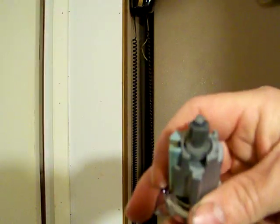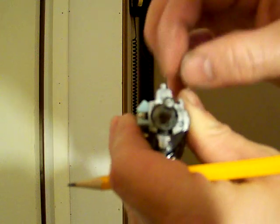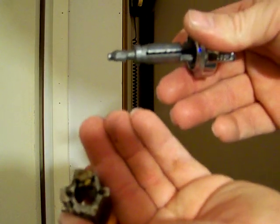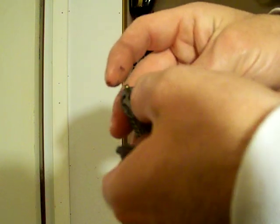There's a pin right here — what you want to do is pop it out just a little bit; it won't come all the way out. Then turn it — there's a little slot here, a skinny slot — and turn the cylinder all the way around until it lines up with where this pin is, then it just slides right out. You'll see you get two halves of the cylinder. Also, there are two pins in the top of this cylinder — be sure not to let those fall out, because those give the detents so when you turn the ignition on and off you'll feel the click.